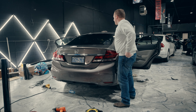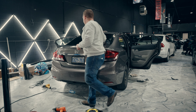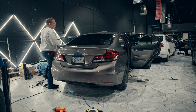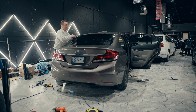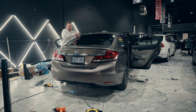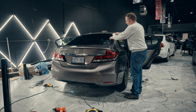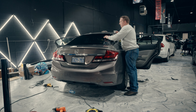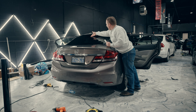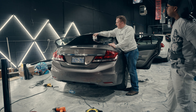Now we have everything on the glass. I'm going to pull my hand in the center, pulling that film across and drawing a line. Pull the center up, pull it across, and draw a line. We want to build out our four quadrants. Take my hard card and reinforce that line, then come down the center and across — building the letter H. I'm going to do one more line down the center of the actual piece of film, up the center. This gives us four quadrants.